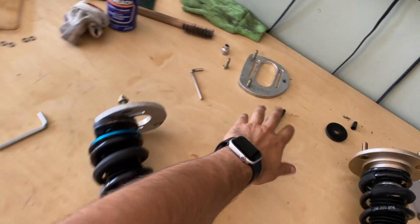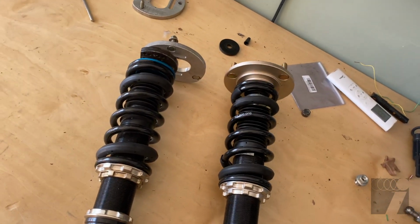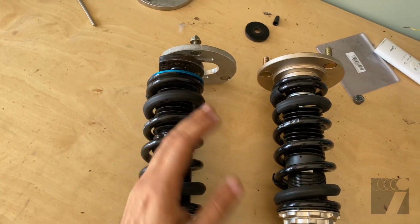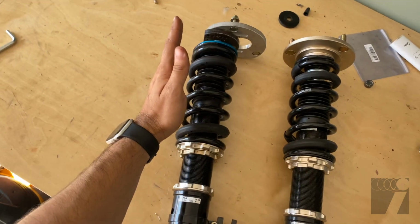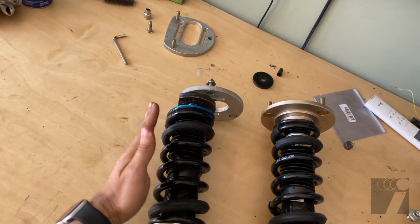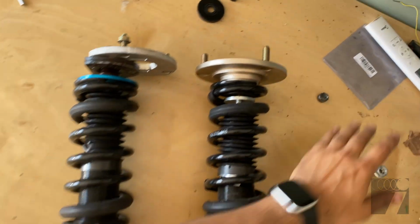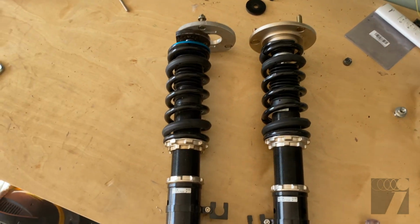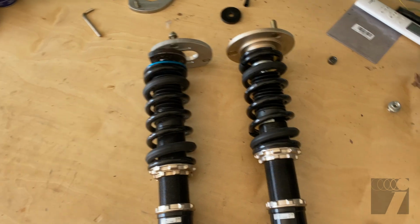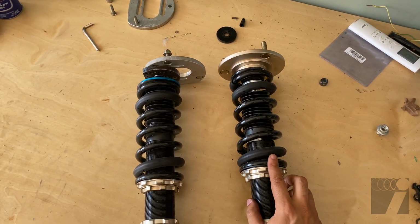All right, so now there you have it. If you take a look at the difference of the coilovers now, one is gonna be super tight away from the control arm and leaning more towards the shock tower, I guess, strut tower walls on the inside, while this one will stay more in line, if anything. So we'll have a lot more clearance from the control arm hitting this now that this is leaned over. So I'll make the conversion on this one right now, and then we'll get ready to install the coilovers.